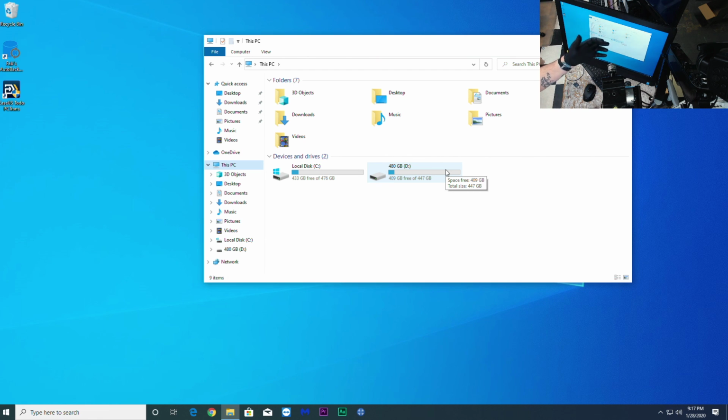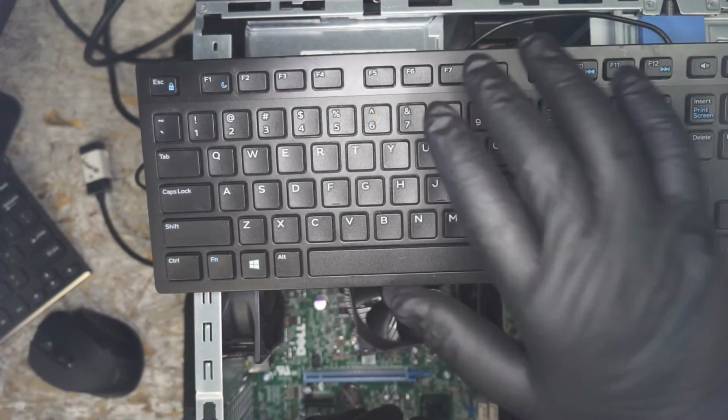If the most recent up-to-date drivers exhibit this behavior or some other weird behavior, like Wi-Fi connecting and then disconnecting, reconnecting at random without you even moving how far you are, say you're right beside your router and your Wi-Fi will connect and disconnect, reconnect, disconnect, or just no signal at all. There's other stuff to check on, but also try older driver versions that are still compatible with your operating system. That's always a possibility.